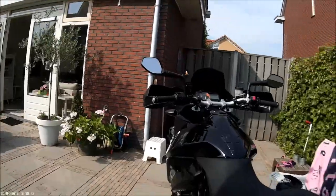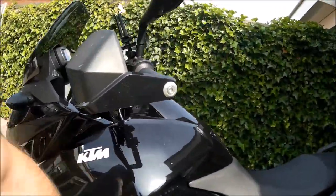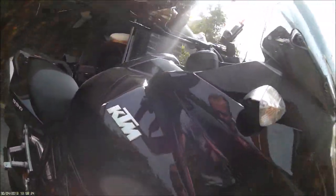To start, fire up your engine, drive around for a few minutes, and make sure it is at operating temperature before you start synchronizing the vacuum in your throttle bodies. I've done some work in advance. This is the bike I'm going to be working on. I've removed the side panels from the tank just to speed things up.